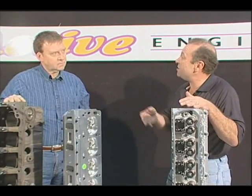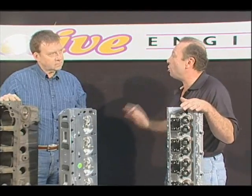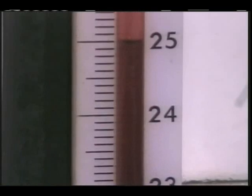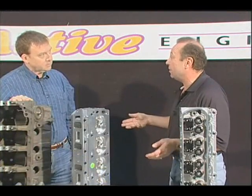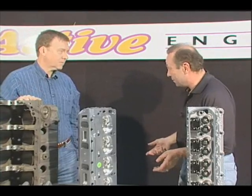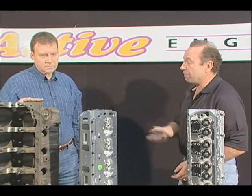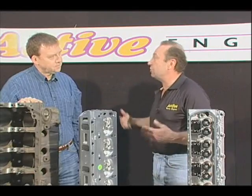But at the end of the day, regardless of what head you pick to use, it still has to be checked. If you're trying to hit a certain number, you can flow it on the flow bench and know you're there as opposed to hoping you're there. When you flow a head on the flow bench, you open the valve in steps at a set pressure and take readings. You can actually drop that valve right out of the head and it doesn't flow anymore. What that means is: if the head stops working at 500 lift, don't put a 700 lift camshaft. Once I know what the maximum intake flow number is, I can predict at what RPM this induction system can feed your motor. So if you've got a 408 inch motor and a pair of heads that will only support 5,000 RPM, don't put a camshaft that works to 7,000 RPM. It helps us pick the cam as well — we guess at very little here in the performance industry.